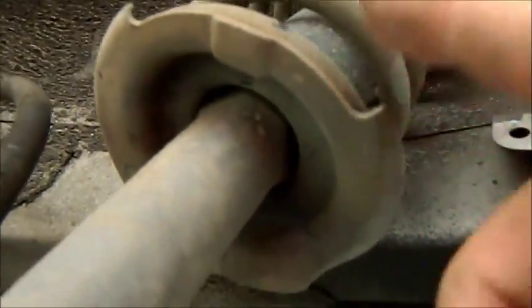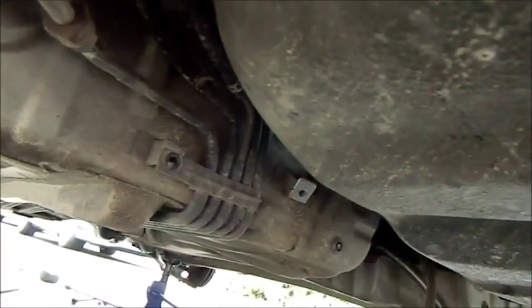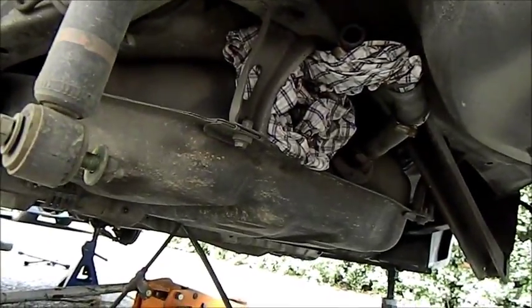These are the struts off the old car. I've put those back in temporarily because I'm going to put the rear axle from the other car in as well. I've taken that out. So I've got all this release. It's just held in by 4 bolts, one at each corner. And I'll unclip those lines there. Again, I'm not using them either. I've got the other ones hanging up. So handbrake's released, all off, the rear axle's out, so that tank is ready to drop.